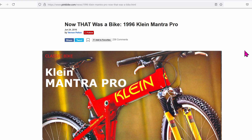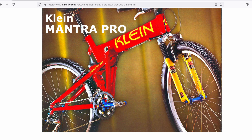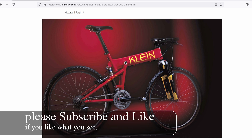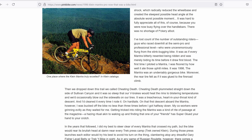Today, I'm going to show you how to convert a normal boring bicycle into a nice electric bicycle for about $700, assuming you have all the tools already. Some tools are very specific, especially for removing the bottom bracket — this highlighted area right here — while most tools are very common such as Allen wrenches. This full suspension bike is ridiculously light, around 25 pounds. With the added motor and battery of 16 pounds, we should get a total of about 41 pounds by the time we're done. Spoiler alert: it's 41 pounds when we're done.